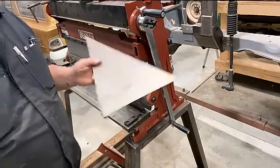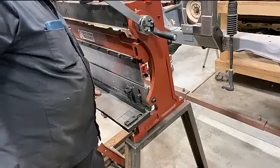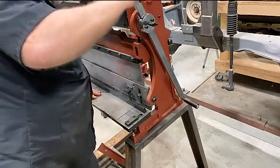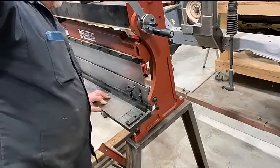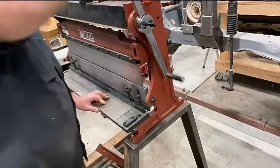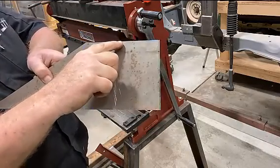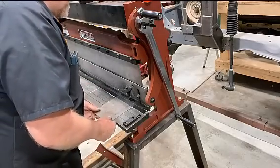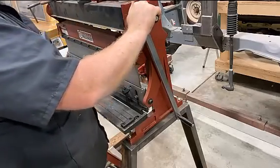All right, so got our piece of steel here sheared out. This one line I traced on it is not actually a straight line where I cut it out with that wheel, so I'm gonna cut it back to the highest points of the paint and then we'll grind it back the rest of the way. See, that line's kind of bowed that I ground out, so I took it to this high spot right here, and we'll just grind till we grind all the blue away. Now, we'll shear it in the middle of those lines. And then put our flange on.